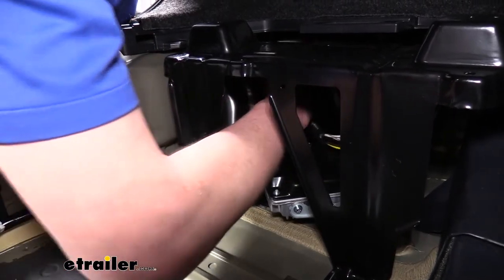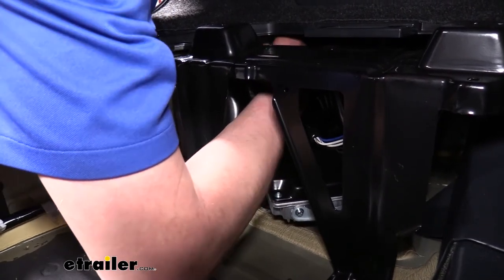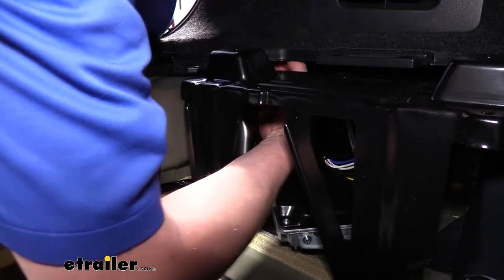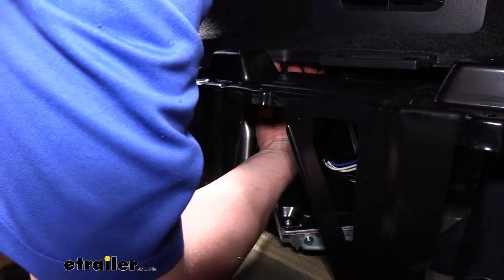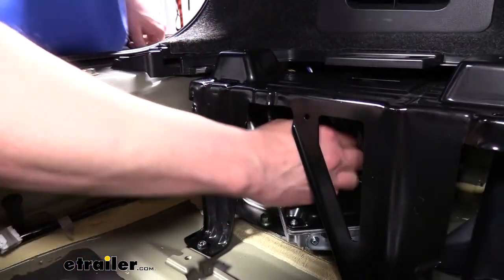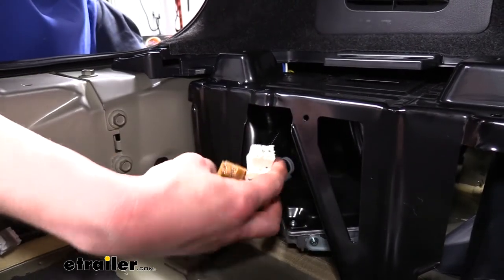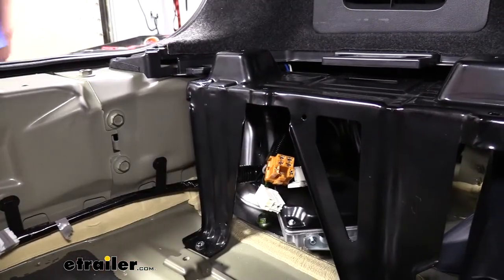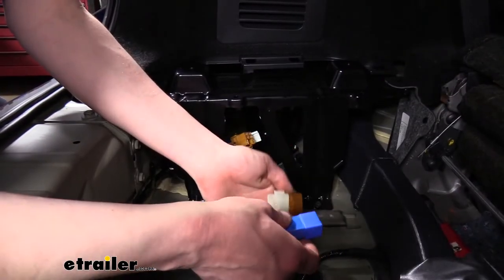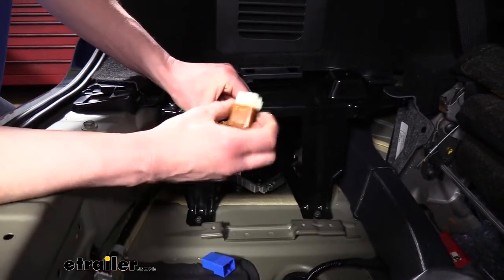Go into the large opening and reach back — it's usually easier if you can get your whole harness in there so you can move around more easily. Take the connector and plug it into the white connector towards the back, then plug in the black connector as well. The black connector can be a little more difficult just due to it being slightly higher up. Once both are clipped in, bring out the relay and plug in the relays included with the kit — using two blue relays and one brown relay, line them up and plug them into the connector.